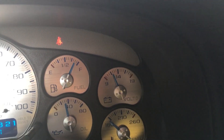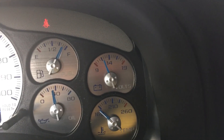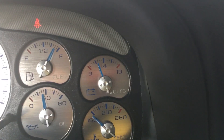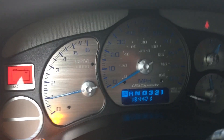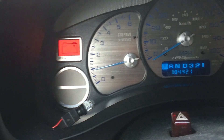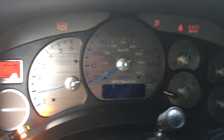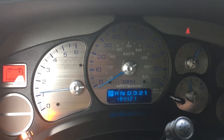Typically with the engine running, the alternator charges the battery so that it would be above the 14 mark. And as you can tell we got squat and we got that light right there coming on and off. So we turn her off and she starts up fine, which leads us to believe that our battery is okay, but we'll do some further testing.